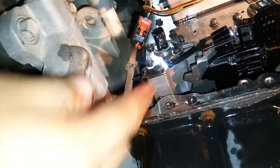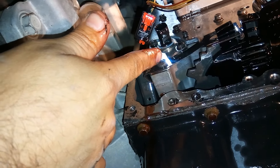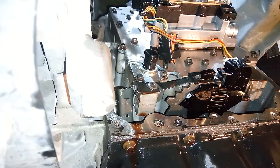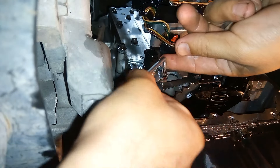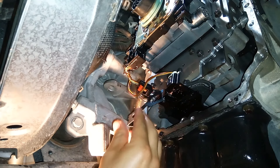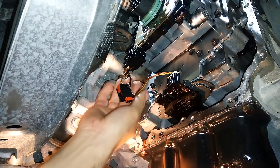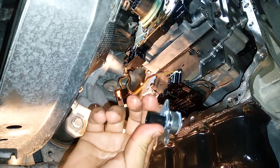This piece right here is on top of the sensor, so you're gonna need to remove this bolt — I think it will be a T25. So remove that T25 bolt. We remove the four bolts and we're gonna remove this little bracket right here that has the roller for the transmission speed sensor. Now we have our sensor — just pull it out. There it is, our sensor.